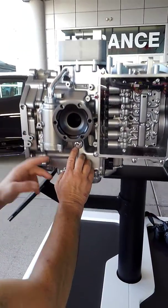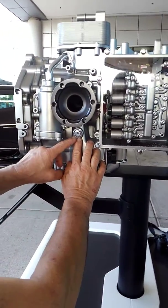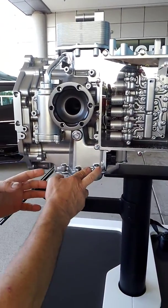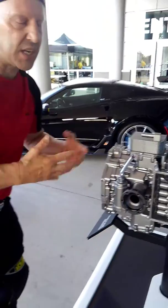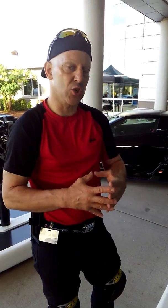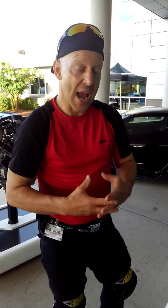Sight plug — take a look. There's no dipstick, so I believe this is your fluid level sight plug right here. As with any technology, it's going to be a learning curve. The key thing to understand behind the dual clutch transmission is that electronic control will be the key, and how it works with the engine control module to seamlessly provide torque to the wheels.